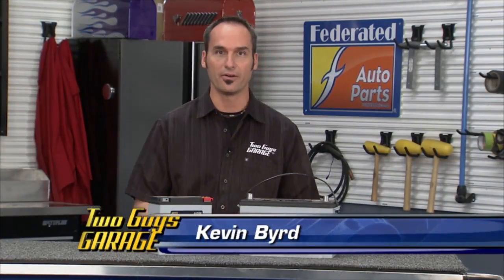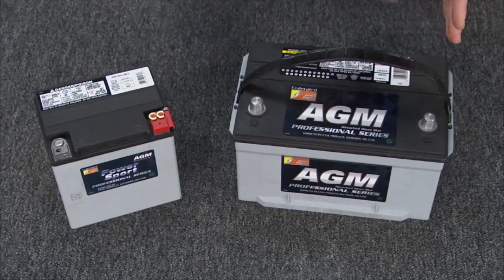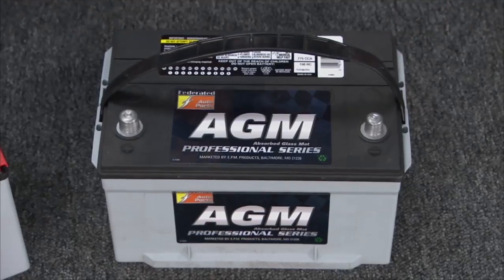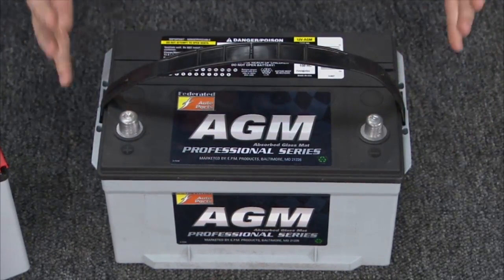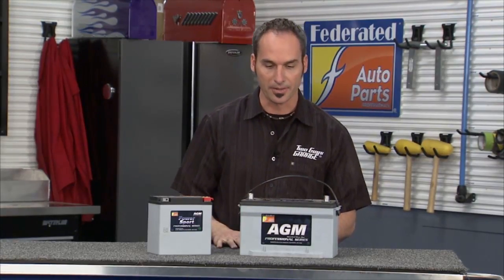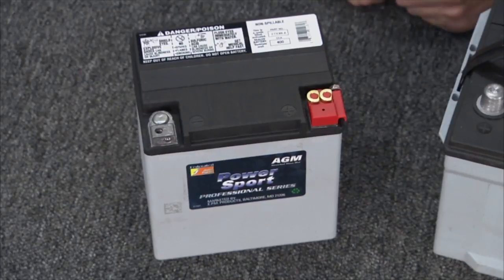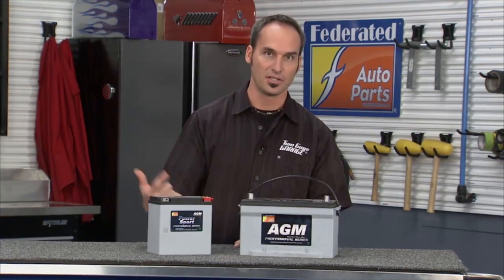Today's vehicles need a more durable and powerful battery, and that's handled by the Federated AGM — absorbed glass mat technology. Instead of lead plates just hanging in space with an acid bath that can shake around and fatigue over time, it's absorbed glass mat — compacted with a glass mat, all that acid absorbed inside, so it's sealed. You can tip the thing over. It's got about 20 times the vibration resistance, and with modern technology in cars — GPS, third row seating, ambient light, all that draw — it's about twice the cycle capability of a typical lead acid battery. The sports version is for ATVs, motorcycles, and race cars because they make enough cranking amps to fire up those race cars but they're light and compact.